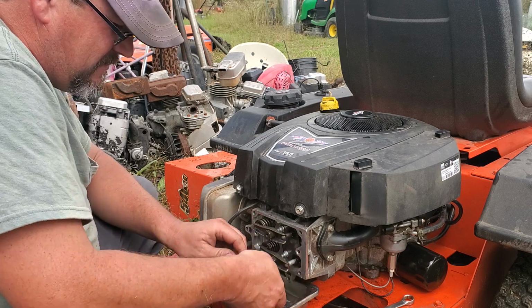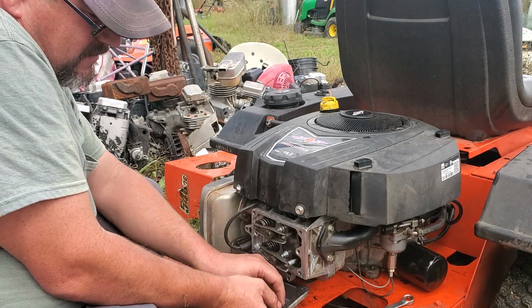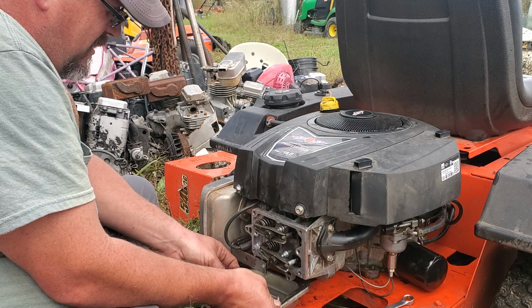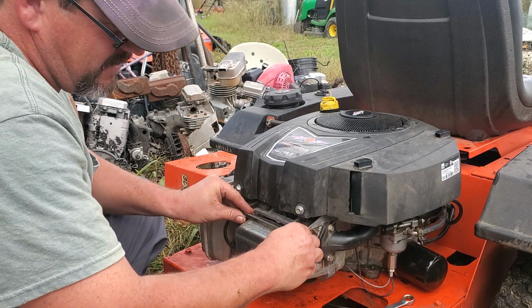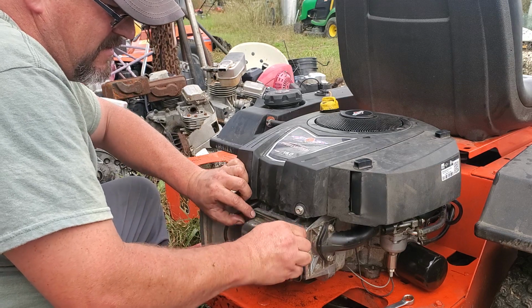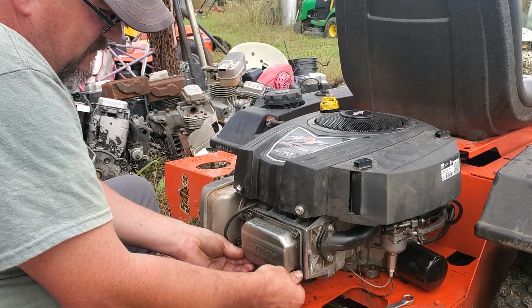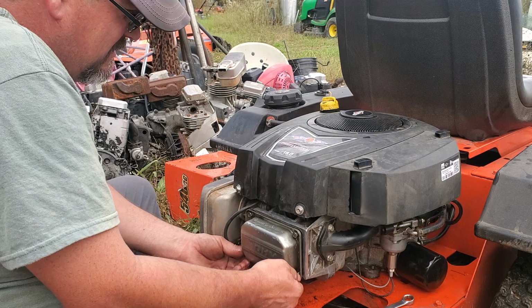So what we'll do now is I set the valve cover gasket on the valve cover and run 2 bolts through the gasket, and then you want to move kind of quickly so that you don't dump a lot of oil everywhere. The oil just didn't have time to really go all over the place. But if you can't, you can't. Sometimes it gets all over and I have to wash this machine anyway. And there's a big covered box basically that goes around everything on this mower.